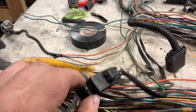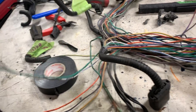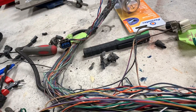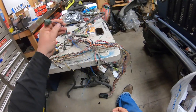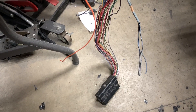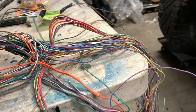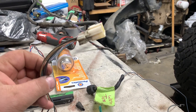I'm going to keep this one and put it back in — this is my camshaft position wire, that's what I was trying to find. The alternator — don't need that one. This is your coil and another O2. This plug here was never used on my Jeep so I'm snipping it. For right now I'm going to leave the transmission harness plugged in. The next one to remove is the last O2 sensor.